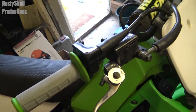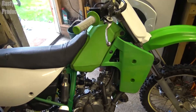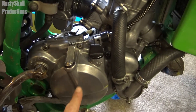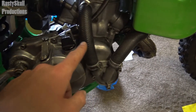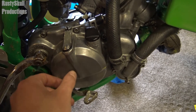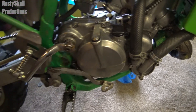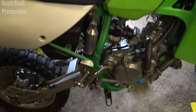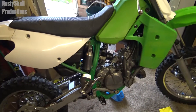At least I've got these on — all this is good. I think the clutch has had it though, because it's on full adjustment and it don't like it, and you can't move the spindles. The only other way would be to take the housing off and move the spindle splines on the inside, like you can on the RM. But you can't do it on this one. So that's that — another hurdle. But I've told him many times, he won't buy a kickstart. So there we go.